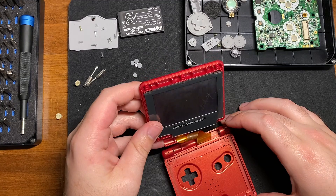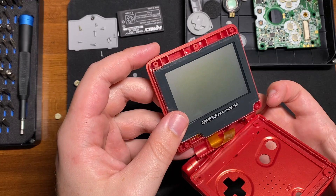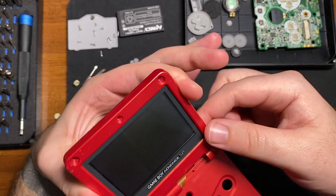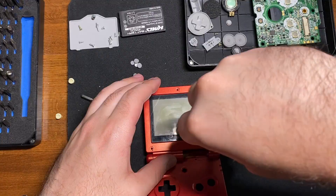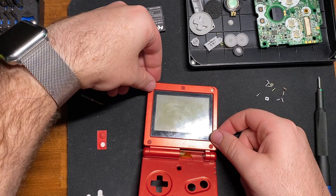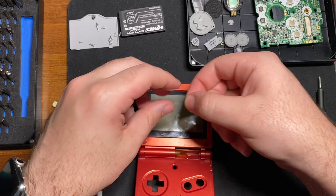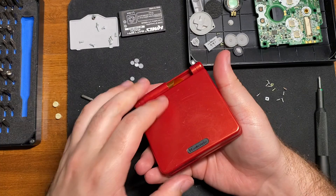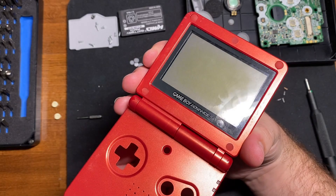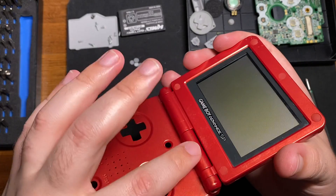Now we're going to do the screen. Slot the ribbon cable in first so that it's in there, then fold it down and line it up. You can see the ribbon cables come through. Open it and now put the screws in place. Your three flat ones go on the three tri-wing points and the thicker stopping ones go in the top two corners. That will help it so when you close it shut, put the cover on — it does just slip in right there. It's not a very long screw, but if you feel any resistance, stop and figure out if you have the right screw.